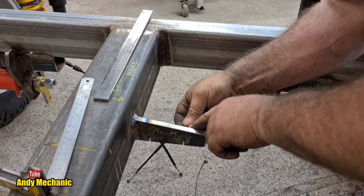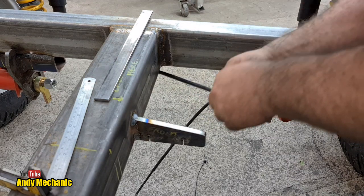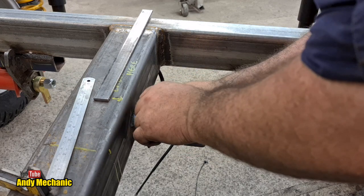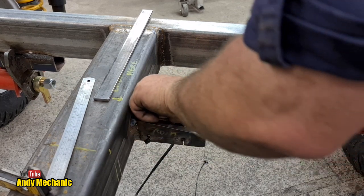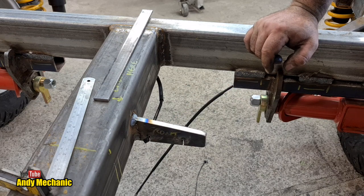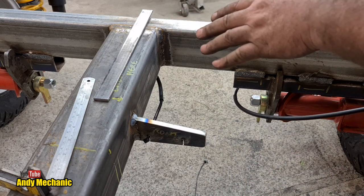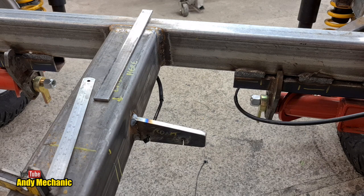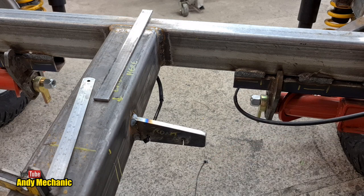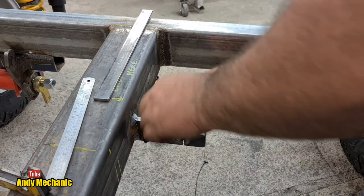Right, just lining these up so we can slot in the cable. Or cables. Okay, we'll do the inner one first, which is the right-hand side brake. Yeah, that should work. There we go. We'll just twizzle that a little bit so it can't go. See, look, there's not a lot, is there? That balance plate is going to be really close. There is a bit more adjustment left on the cables, and we can minimise those, because they will be used to help with the balance anyway. And then the actual brake can be adjusted on the rod itself. Okay, jeez. Complicated to make it all work.